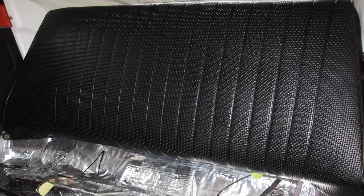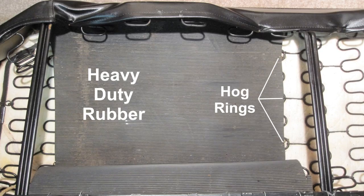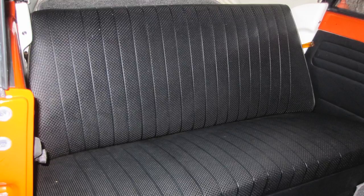The back of the rear seat is installed. Install a heavy-duty rubber sheet on the bottom of the rear seat over the battery area to prevent catching the car on fire should the seat press down on the battery cables. Now install the rear seat bottom.